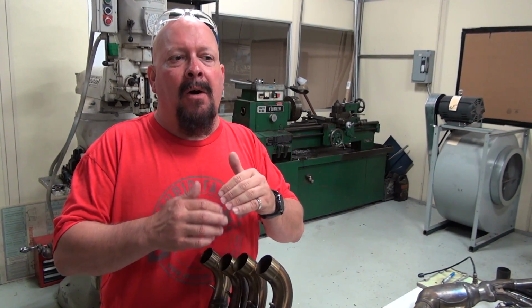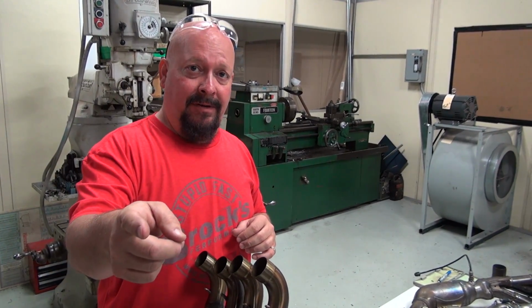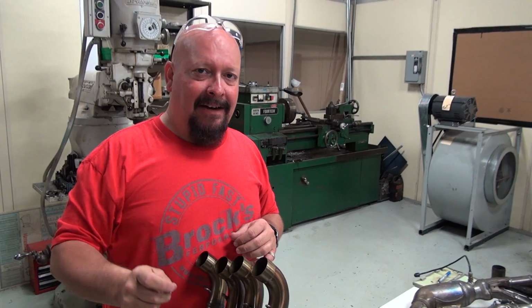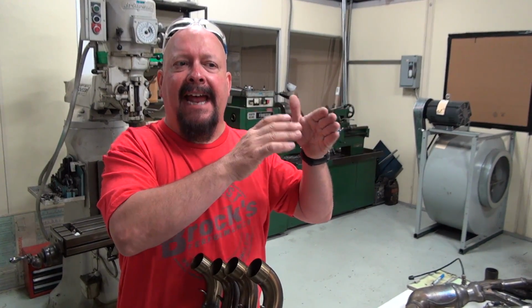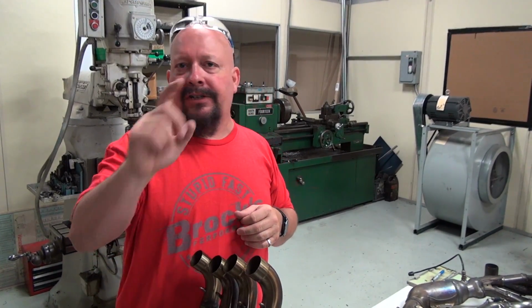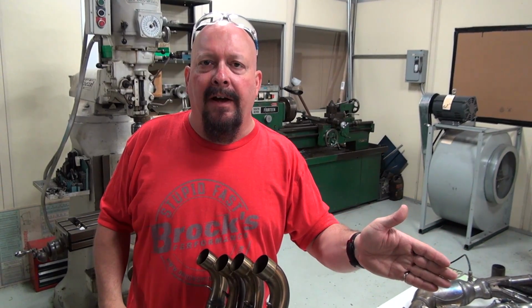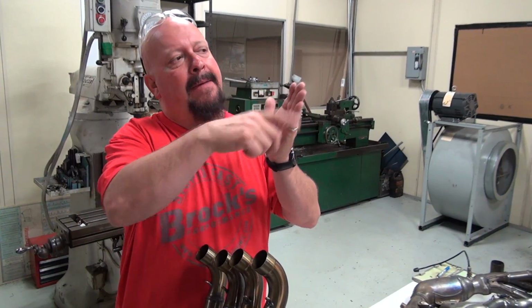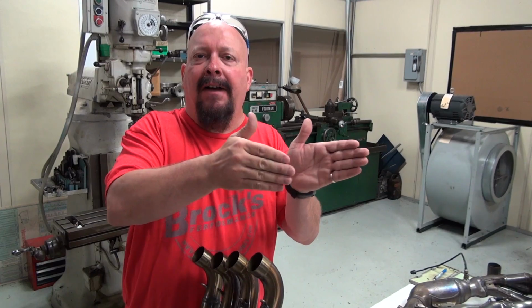And you know, have guys argue, well, you don't make positive pressure until 150 or 160 miles an hour or whatever it happens to be on that particular bike. True. We're not worried about positive pressure. What we're worried about is the pressure in your intake being less negative. So just do yourself a favor and think simply like I do. Put your hand out the car window at 60 miles an hour. That's about the same amount of area as most ram air ducts. Feel that pressure. That's what's forcing air into your airbox.